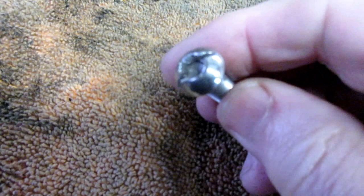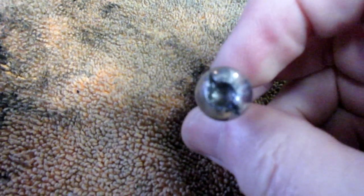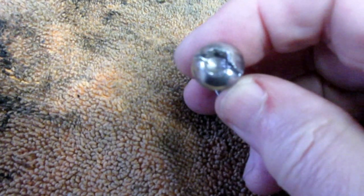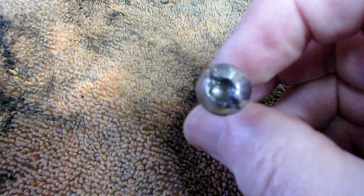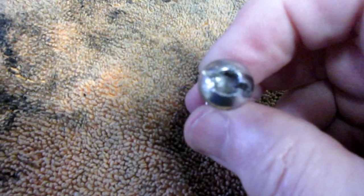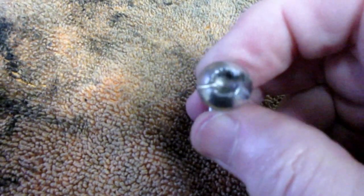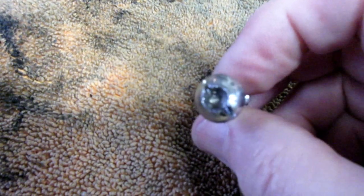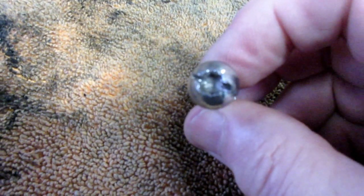This is what happened. We always have one bolt when you go to take the discs off, one or maybe more. In this case, we had one bolt that just was locked in for whatever reason. I don't know what happened, and we just couldn't get it out. Well, what usually works is to heat the bolt head. And that's always choice two. That makes it a lot better.